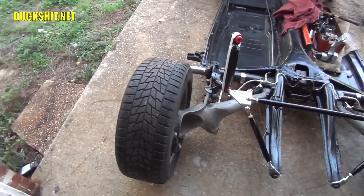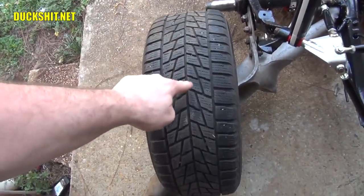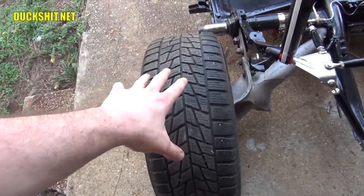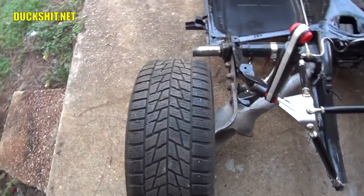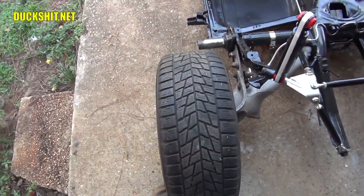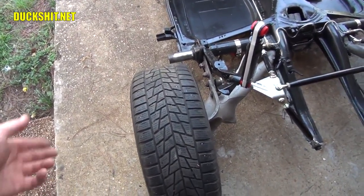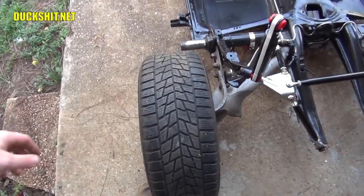Now, this is part of the tire design. What the design is supposed to do is that as this is driving forward, if you would see this contact patch on the bottom of the road, the arrow actually faces back. And what it does is it sloughs off the water, so it tries to help you from hydroplaning. You can still hydroplane if there's enough water or if you're going fast enough. But of course, if your car is light enough, welcome to Volkswagen land.